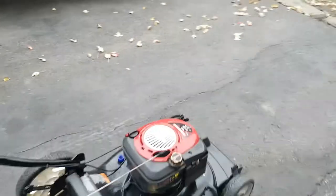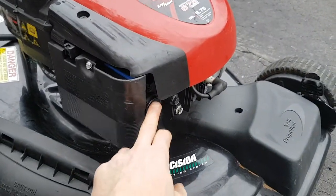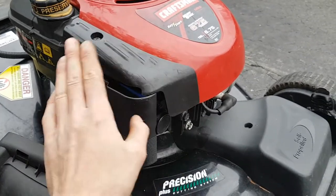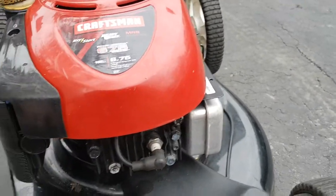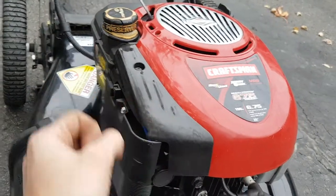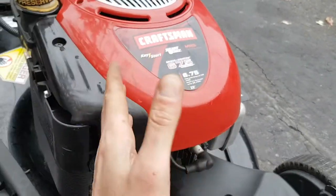This is of course the Briggs & Stratton without the primer circuit — they've actually omitted the primer bulb here. There's a choke flap that is governed by a linkage that goes across here to the thermostat on the exhaust muffler. When the motor is cold, that choke is closed, and when you go to turn the engine over it's sucking fuel through the emulsion tube. Then as the exhaust heats up, the thermostat opens.